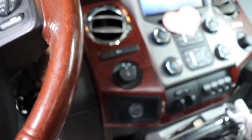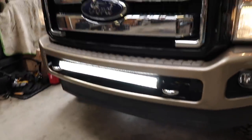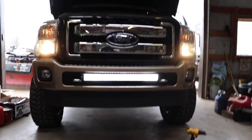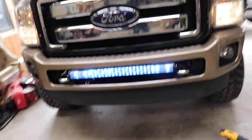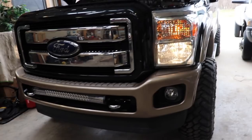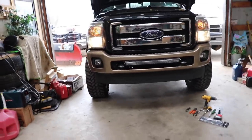I love these auxiliary switches. So you turn the key on — auxiliary one — and that's the white light. Looks very very good, very very bright, almost like a projector LED style. Flip that off — auxiliary two, or upfitter switch two, whatever you want to call it — and there's your blue light, which looks really really good on this truck. We still have two more auxiliary switches, and since it is so easy, I've actually got some cubes I'm gonna look into to swap out with those to give him some brighter fog lights as well.